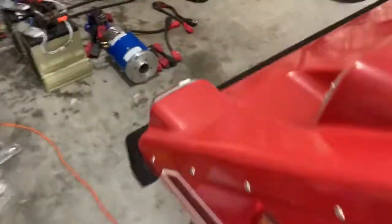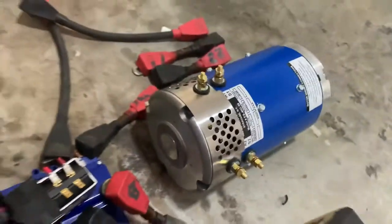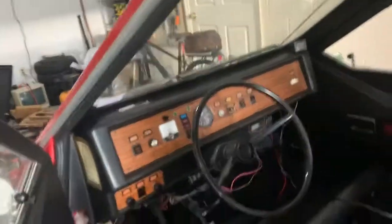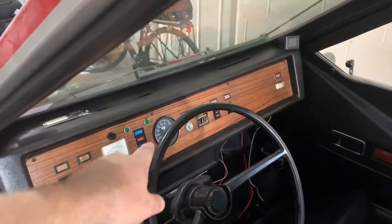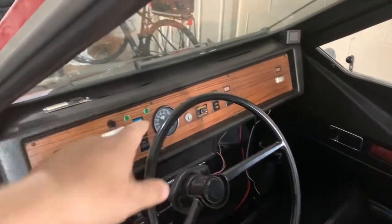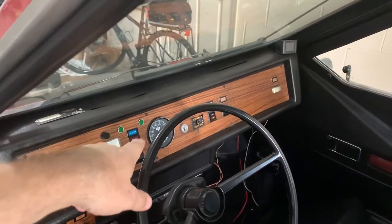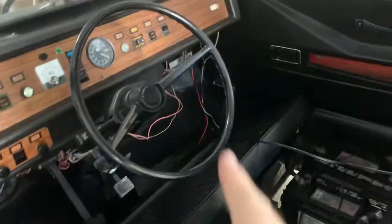There's a speedometer cable out here, and I don't know what to do about it because the new motor doesn't have anywhere for it — he's capped it off, there's no hole for a speedometer cable. I can't even put a hall effect sensor to detect the RPMs. So what I'm going to end up doing is getting a GPS speedometer, and I'll actually be more accurate because this thing is currently off by about three miles. I inflated the tires to correct pressure and that fixed it a little bit.